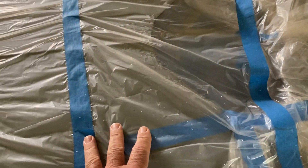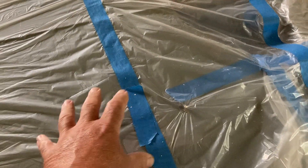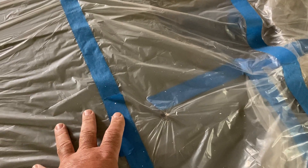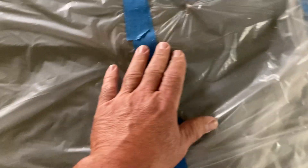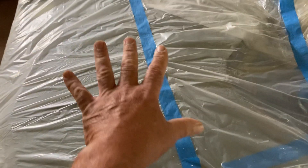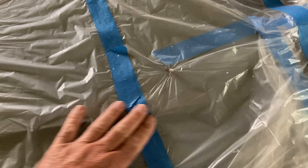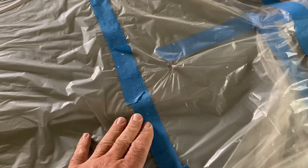It's all fitted and finished underneath. This hood is prepped and done — blocked a couple of times and in final prime. It blocked out good. There was a little damage on some edges from someone strapping it to something; Junior had worked all that out, filled it, and blocked it. It looks mint.